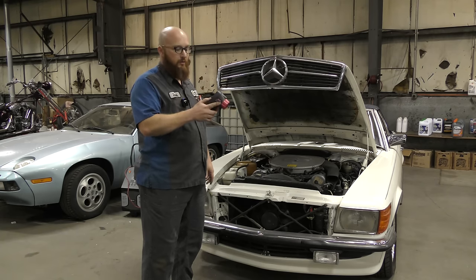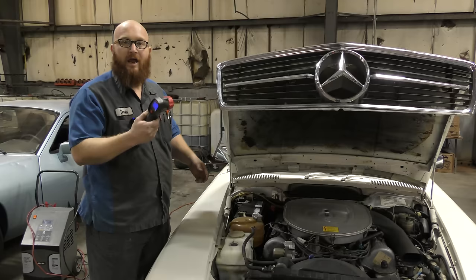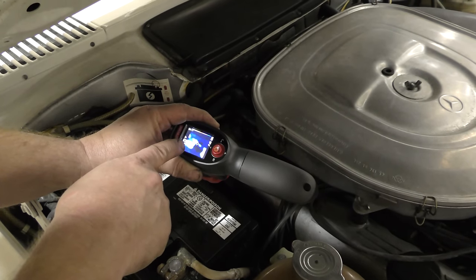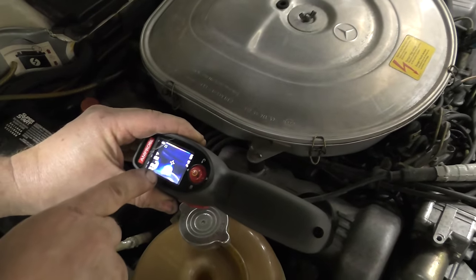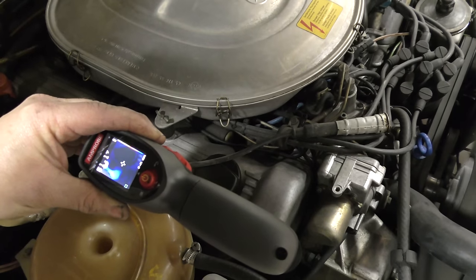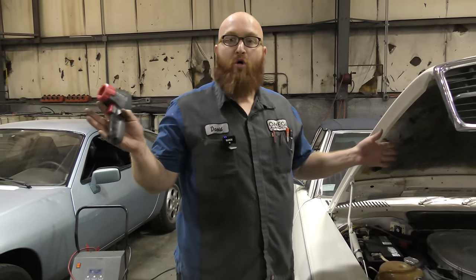We can hear that it's misfiring, but what if everything's hooked up properly and the question is, which cylinder is misfiring? This is just a little camera — you can shine it real fast and get the answer. You can see the orange right there is the very back cylinder on the exhaust manifold. There's the third one from the back, there's the second one from the back. You can actually see the heat on the exhaust manifold. I've unplugged the forward cylinder — let's look at the exhaust manifold there. Look, guys, it's blue. Ice cold. Compare it to the others — orange. No more questions. I exactly know what cylinder is misfiring.